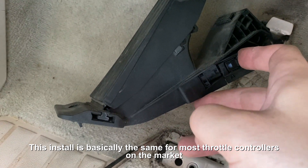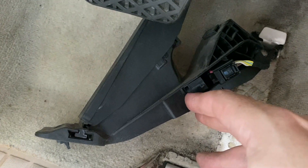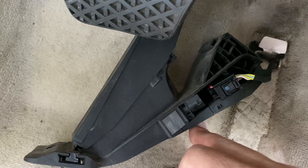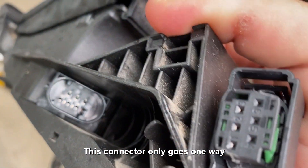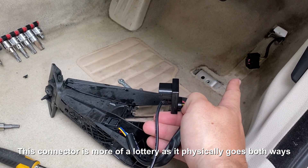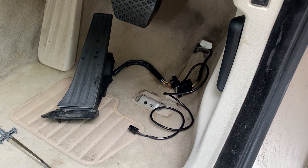It was a bit tricky. When I was squeezing the tabs with one hand, I used the other hand — just got a flat-bladed screwdriver and pried in between this part here and the edge of the connector. Now we've got our harness. We note the numbering on there, we've got our pedal, we note the numbering in there. Then the other side we're going to plug into the body harness — the end of the harness for the controller — into that black connector there.